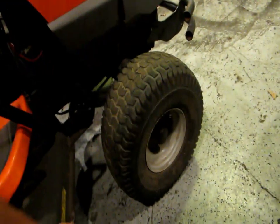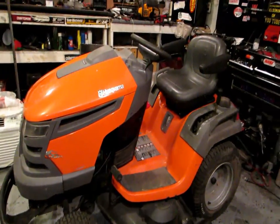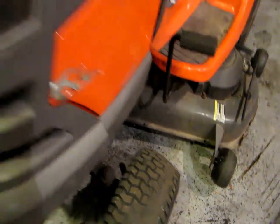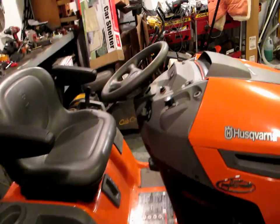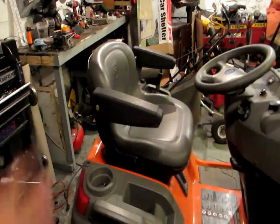I have replaced two of these little wheels just because they got loose — I lost one at a customer's house when I was mowing their yard, and one was just kind of loose and wobbly so I figured I'd fix both. Eventually this fall I'm going to be putting some new tires on it; I'm starting to have a little bit of tread wear. A few months ago I had to readjust my front-end ball joints — they came a little loose so I had to re-tighten them. I've actually put bigger tires on it in the summer. I run 22s — these are 22 by 9.50-12 NHS tires.